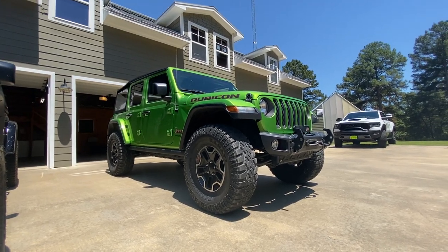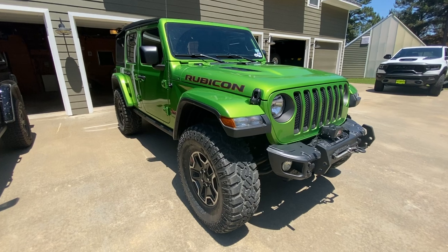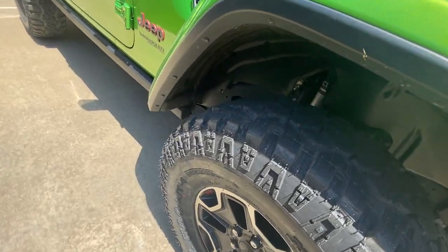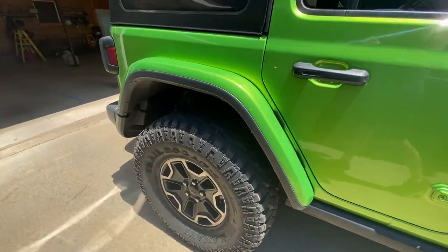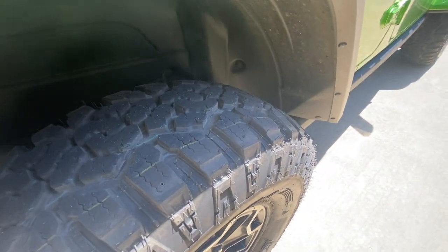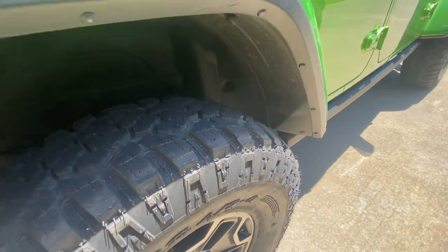The section width appears to be a little narrower than my KM2s — they sit a little narrower. It's a higher profile, looks like a little bit of a crown, probably due to the narrow rims as I run stock wheels. As you can see here, sort of like the Milestar Patagonia, it rides mostly on the center. But I'm getting a pretty good pattern — you can see it's really contacting the road out to about right here, so that's actually pretty perfect.